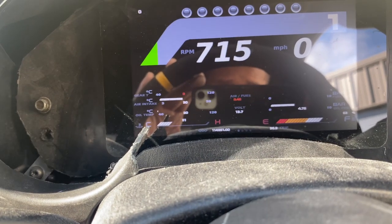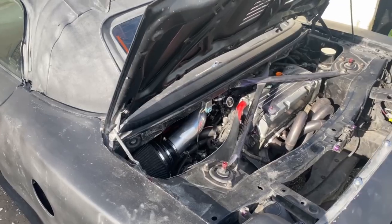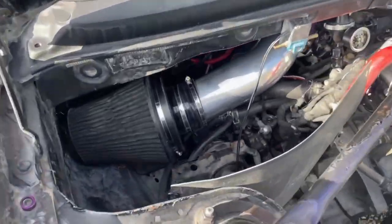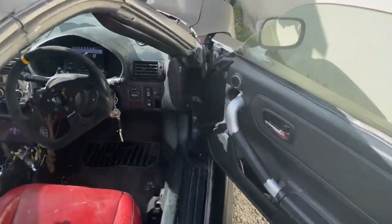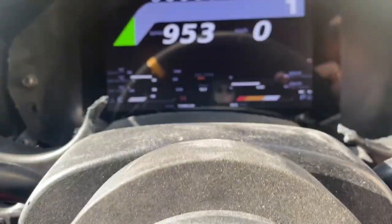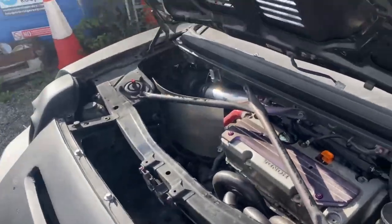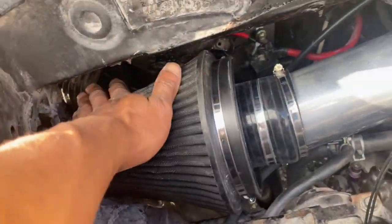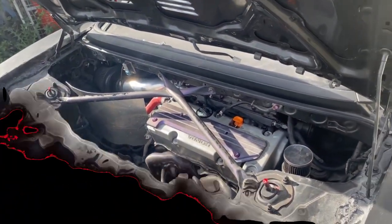I'm going to start the car and see if the idle is not too high - the engine is still a bit low so I might increase it a tiny bit more. After a few minutes of adjusting, I was able to get the filter even further over. I raised the idle to about 950 RPM when it's at 65 degrees - that's fine with me. Hopefully the filter gets more cool air from here, but I'm going to go for a run and see if it's any better.